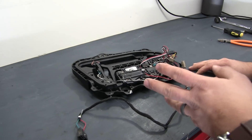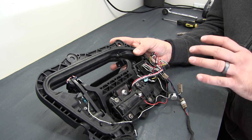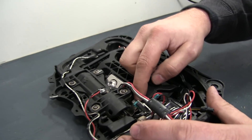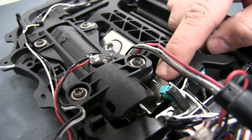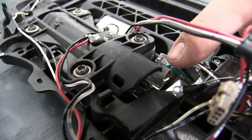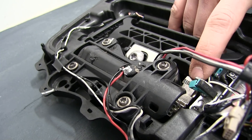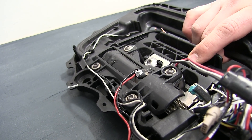The next issue is that you'll come to the car and the handle won't present itself. This is common because of a piece that sits down here. This little electric motor has gears that it meshes into in order to push the handle out, and once this piece breaks — which is actually what's wrong with this handle — it can't catch at all.